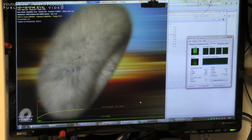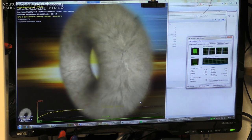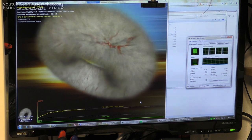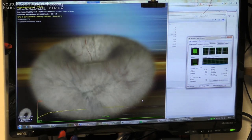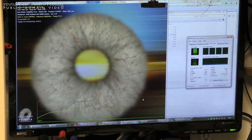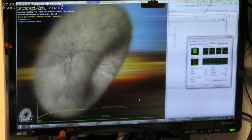Beyond that, I figured out that the GPU actually doesn't do at all what I wanted it to do. OBS doesn't seem to support video card rendering. However, it does support using the Quick Sync ability in the CPU. So I really have no reason at all to have a GPU in this machine, so I'm just going to take the thing out and install it if this thing ever needs to play a game.